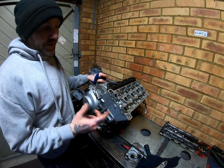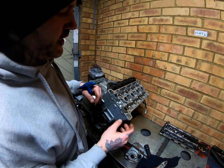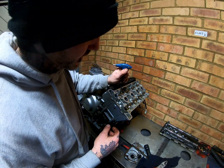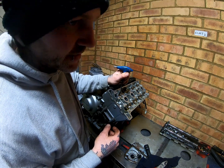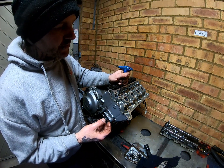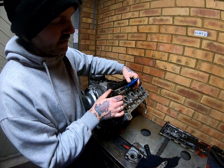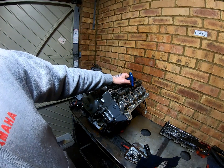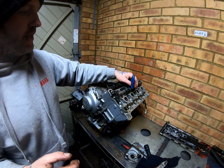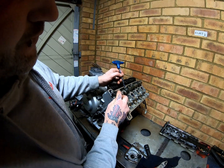Right, now, anyway, the head is pretty much ready to come off. Have you ever heard of anyone talking about needing the valve clearances done? Well, under here there are shims. Between this tappet or bucket, whatever you want to call it, and the camshaft, I'll just get a cam, for example. I want to make sure you're close enough to be able to see this, which you're not really. I might have to do this by hand, so I'll explain it first.